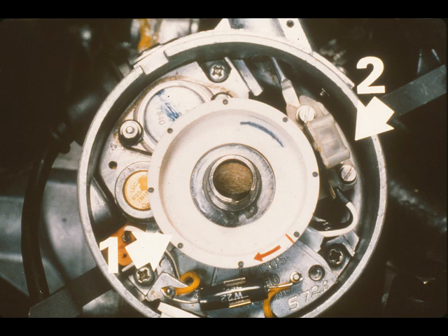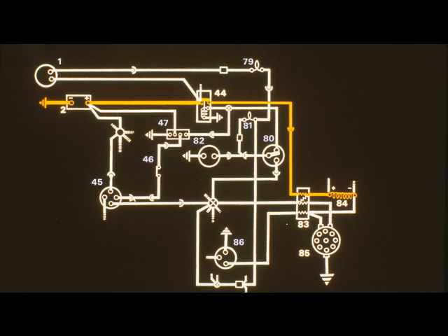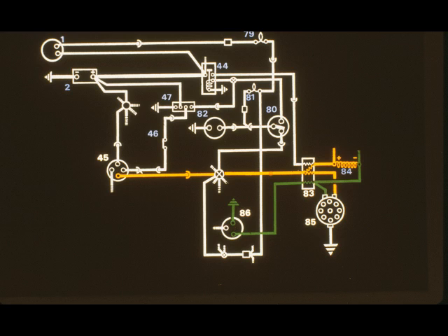The philosophy of electronic ignition is described in the STAVI program, Electronic Ignition. When the engine is running, the low-tension supply shown in yellow to the coil 84 is from the ignition switch 45 via the ballast resistor unit 83. During engine cranking, however, the low-tension supply is from the starter solenoid via a lower resistance in the ballast resistor unit. This ensures an increased voltage to assist starting in adverse conditions. The ballast resistor also supplies current to the amplifier in the distributor 85, and provides the tachometer 86 with a pulse chain from the coil primary winding.